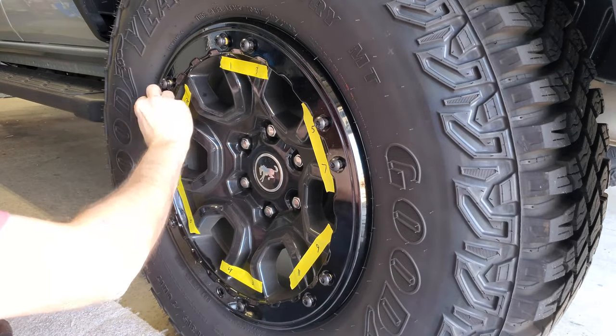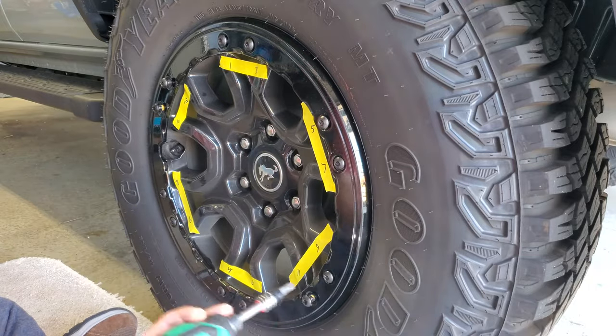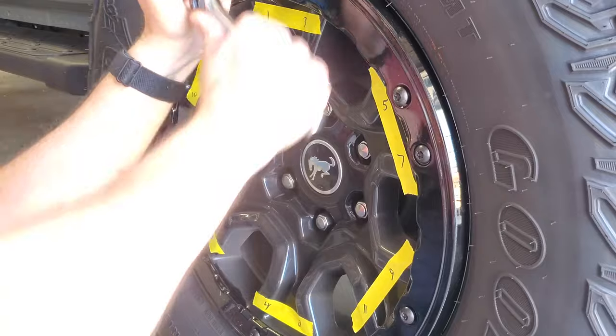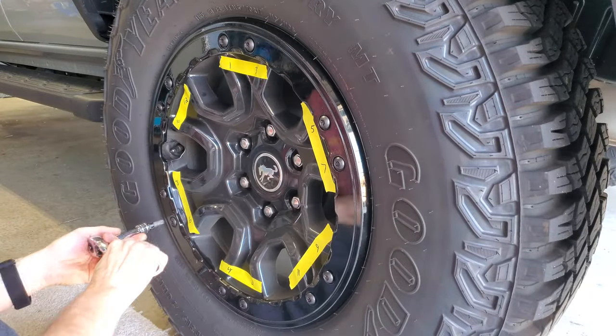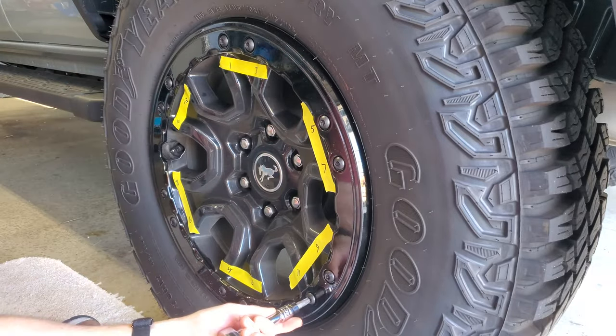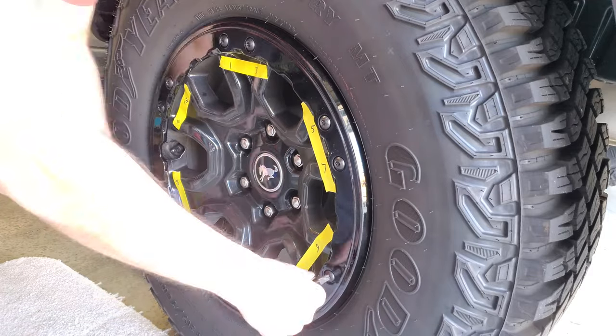I then repeated this reinstallation process on the other four wheels, but I made one small change. I used tape with numbers to mark the tightening sequence. I would recommend you do the same thing if you plan on reinstalling these. This makes it so much easier. I'll also put a link to a file with the sequence and the torque specs in the description below.